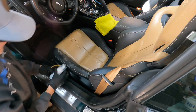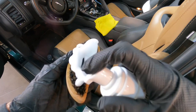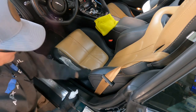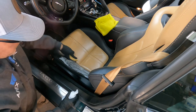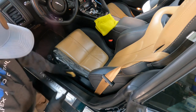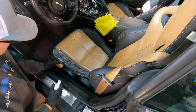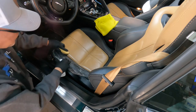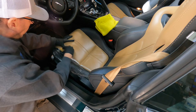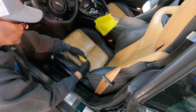Clean between the stitches and where the patches of leather or vinyl come together — that's where it rubs together, and if there's grit stuck in between those areas as you slide in and out of your vehicle, those areas will wear down quickly. So I go after them first, clean it out, and then it's time to break out the foaming gentle cleaner. I'm going to grab my rather soft detailing leather brush and scrub around the stitching and in between the seams for a nice deep clean, starting with the base of the seat and the bolsters.